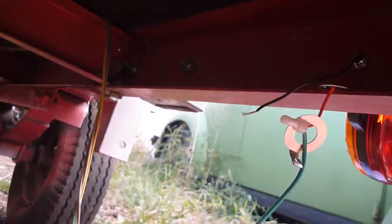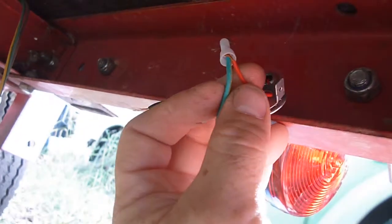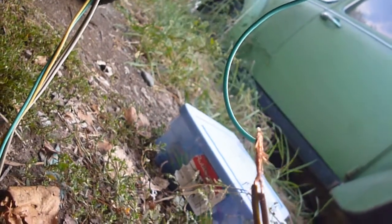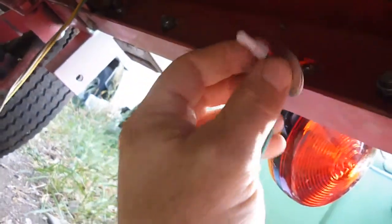While lying up under here, this wire fell clean off and is not attached anymore. Looking at the other one, these connectors are just barely hanging on. What happened is they stripped these wires so long that they just had the tips up inside there and it's real loose. So if you get this kit, take a look at these — you may have to put new connectors on them, because these ones are not on there very well and that will probably cause some pretty severe corrosion. You may have to either re-crimp them, put different types of crimps on, or solder them.